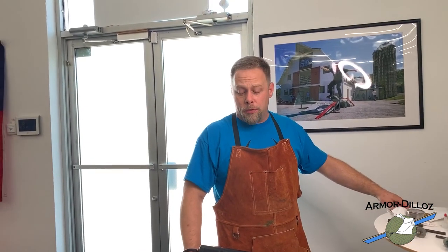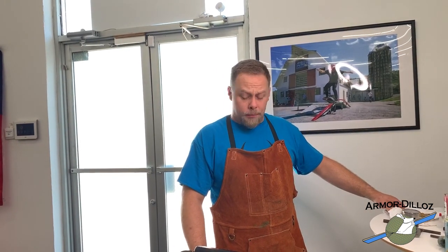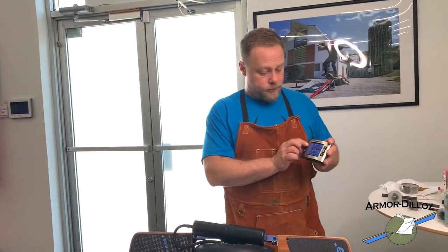Yeah. I mean, that way we've got maximum pressure against it. Two reasons why we want to do that. One, it will seat the plugs better, so higher pressure does seat plugs well. But beyond that, it's going to put more pressure behind it. So if they're going to fail, this will make them fail. So if they'll have a blowout, this is where we'll get the blowout.